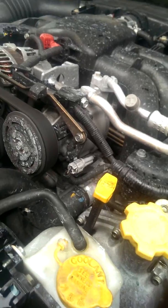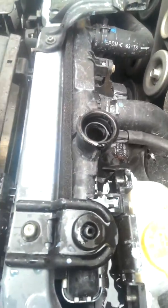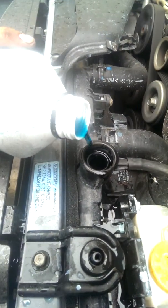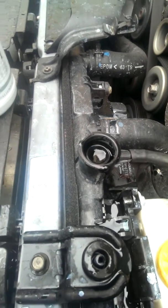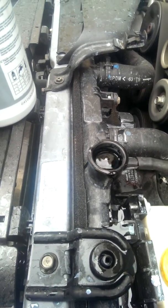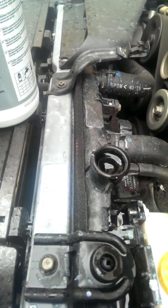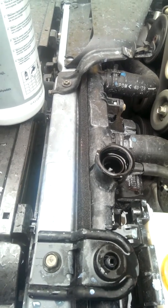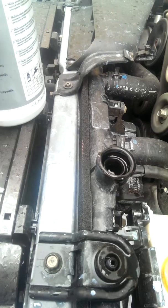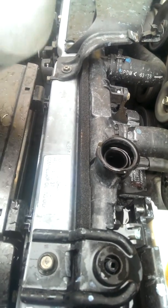You can see the marks from the coolant over here from when I opened the cap. The coolant level has dropped again, and this goes on and on. You might think you've filled your cooling system and you haven't. This leads to no end of trouble, including cavitation within the cooling system, which is when bubbles and turbulent water wear out parts that aren't designed to be exposed to that sort of turbulence.